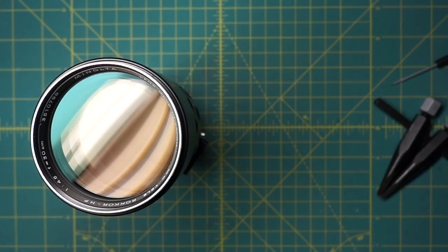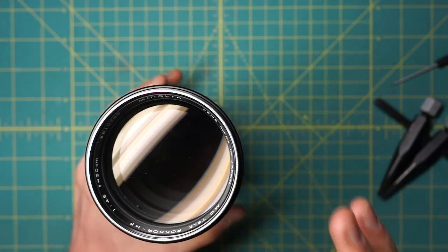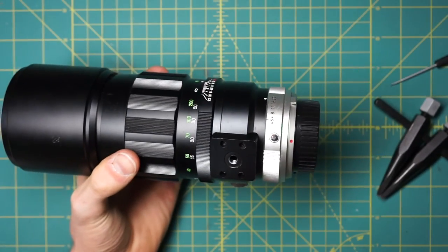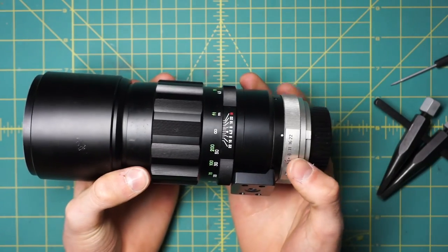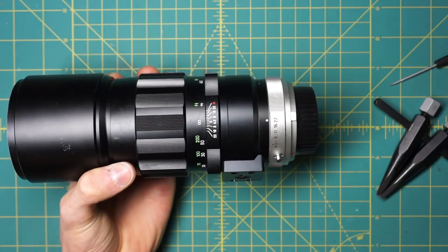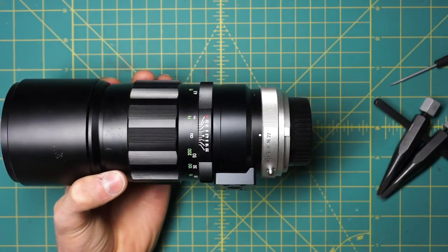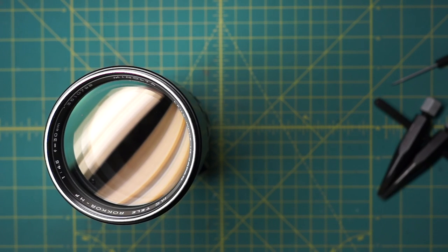Overall, I'd say it's a fairly hard lens to take apart. To make simple repairs like accessing the diaphragm to clean it off, you really have to disassemble almost the entire lens. We had to go in and remove all the front elements, a lot of different layers within the diaphragm housing, just to remove the diaphragm. Then once you do remove, take apart, and reassemble the diaphragm, it can be challenging to get that piece back inside the lens. The lens does use high-quality components for the most part, but its more elongated and stretched-out design leads to some interesting problems where things might not fit together properly, so you have to be careful to mark where everything lines up. It's definitely a more difficult lens to repair — very repairable, but it might take a little more effort to actually make those repairs.